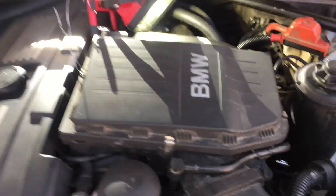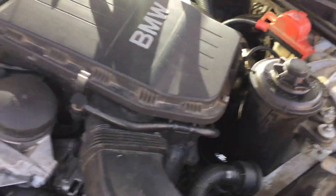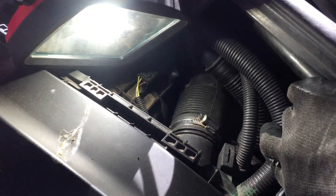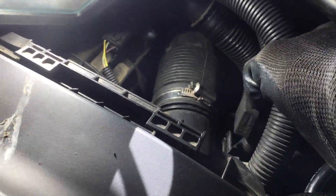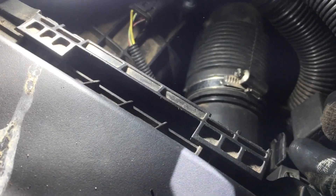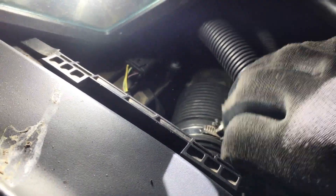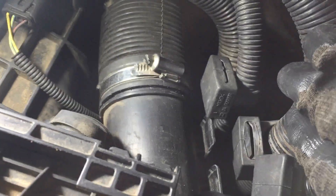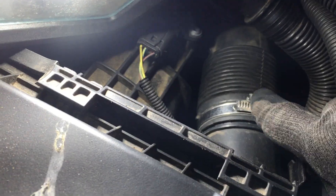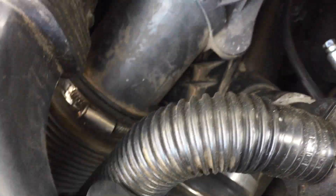Let's go up front. We're going to start off by taking this air filter box off. There's a hose and some more stuff down there. We'll start by unhooking these — they just pull straight up. There are three hoses that hook up to this clamp here. Pull them up; these are already kind of loose so they'll come out quick. If not, you'll need some muscle. These rubbers are hooked up on this bracket. Then we're going to loosen this clamp and this clamp right here — I think they're a six millimeter.